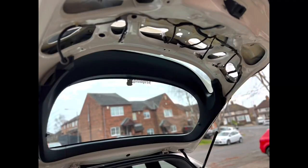I'm going to inject images into this video, so if I stop and pause I'm just showing you what it was. This is a talk-through — I didn't video myself while I was doing it. Initially, you open your boot. The boot trim itself, the big black trim on the top, has two Phillips screws in each of the grab handles on the inside. You pop those out and then the entire thing you'll be able to peel off from around the edge. There's about a dozen or so push-fit clips and that is it — that's all that holds that on.